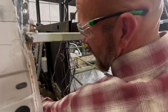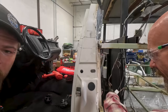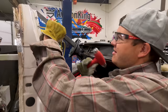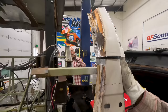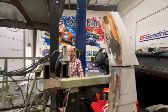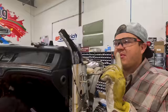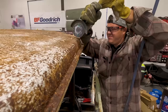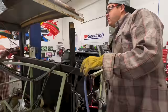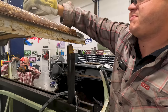Robbie, have you seen the floor brace? Is it rotten? Luckily it's not my first time patching rust on the floor — done multiple derby cars, we can do derby car style rust repair. The nice thing about a seam buster is it breaks through seams. There's almost no structure when you cut the roofs off — it takes every component tied together to actually give strength to all this stuff. We're just getting all the spot welds ground up and I'm going to get working on this roof now, trying to gain some access to this inner structure.